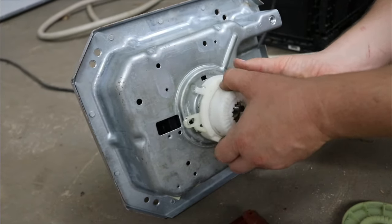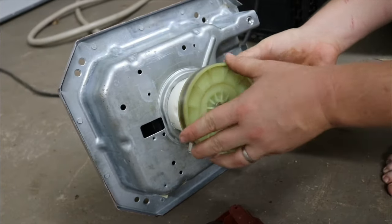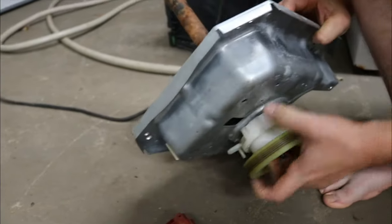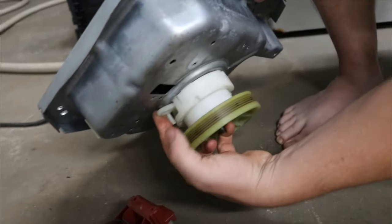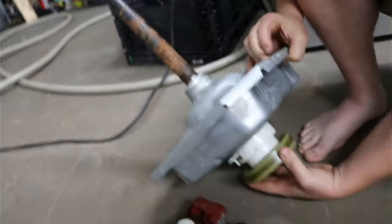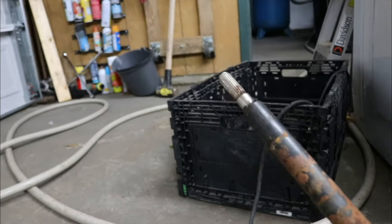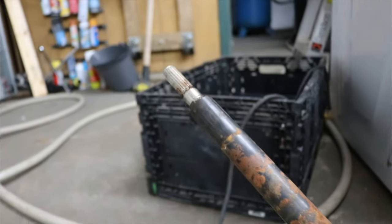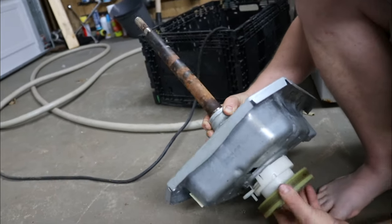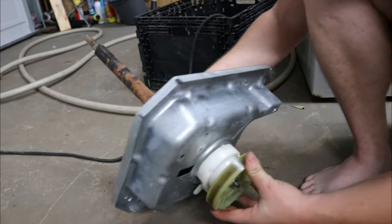Put everything back after you hook this — I think it goes this way. Then we'll put that back on. Now we have a second example of how this works. If I flip it that way, you can see this gear is no longer spinning that one. And now if you look up top, you'll see it's just spinning up top — that's agitation. And if I flip it like I'm the actuator, now the entire thing is spinning. That's all this is doing. It's a super easy to understand transmission compared to the old type. It's not as dependable, but it's a little easier to understand what's going on.